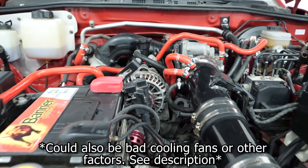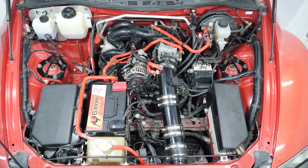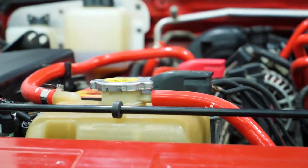A bit of air is still trapped inside, so only after it cools off, remove the cap and start the car again so that extra air can escape. But if it maintains a steady temperature of around 90 degrees, you're more than good to go.